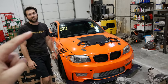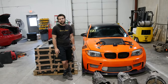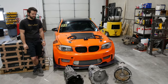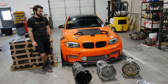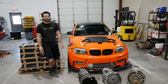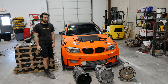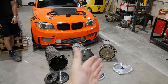Actually, the M235i factory race car you can buy from BMW — body in white, full race car — has the 8HP50 in it. It is used in a racing environment. It prevents money shifts — you can't hurt it. It's used in endurance racing. Even if you're a great heel-toe driver, going fifth to third under heavy braking is hard for anyone. With this it's like a video game — click twice, eight speeds.